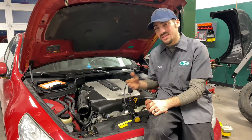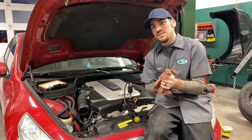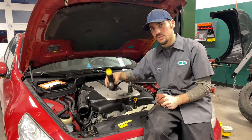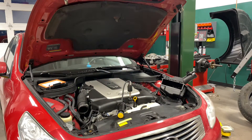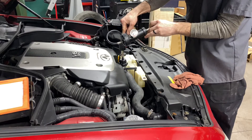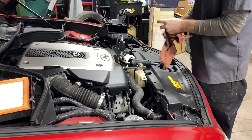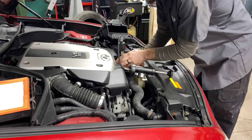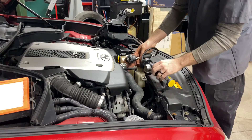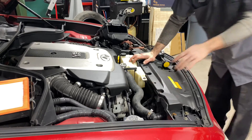With our pressure test, it didn't take very long — our upper hose is leaking. I already have a new upper hose and I'm going to go ahead and install it. Now you guys have some basic knowledge on what a cooling system pressure test is. First things first: if you have your pressure tester hooked up, it will have a pressure release — make sure you release the pressure, unless you want a bath of coolant. I'm going to take this off, put on the new hose, and we'll call it a day. Thanks guys.